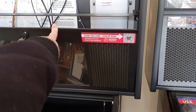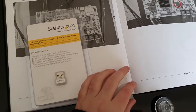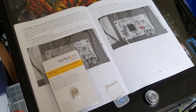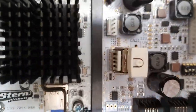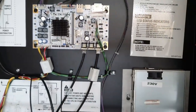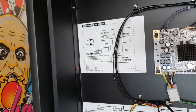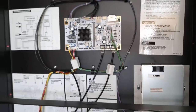We are now at the stage of putting the components in the board. I've put the sticker there, and I've also put the optional sticker in the middle of the coin door. The next thing is to get this wireless Wi-Fi receiver and this little micro SD card into the board. The wireless thing just goes in one of the two USB sockets, and the micro SD clicks in underneath. Some people who get these kits get a wireless adapter instead of the tiny receiver — in that case you've got to mount it on the left and trail the Ethernet cable into the port at the top. Do look up the instructions from Stern if you've got that version.